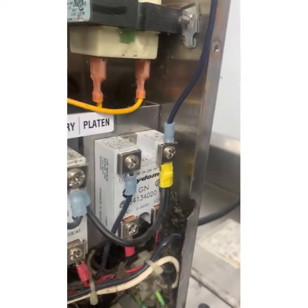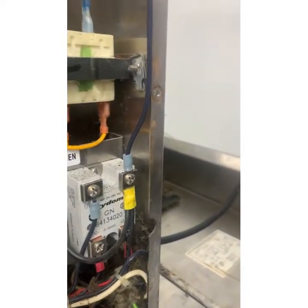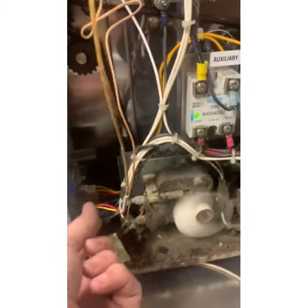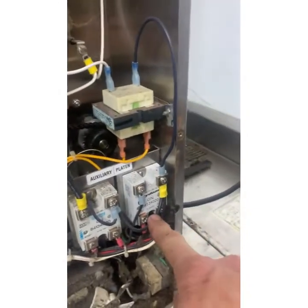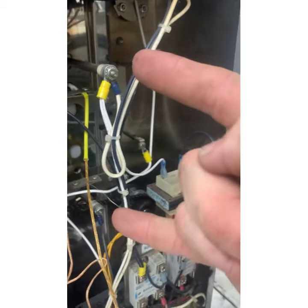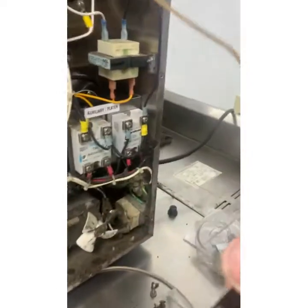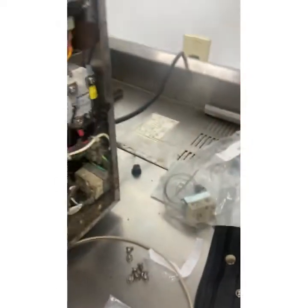You'll notice the relay for the air temp and the relay for the plate temp are sporadically kicking on and off. I pulled this, checked my voltage — this is the solid state relay for the primary plate. Voltage is present. I take my high temp plate probe, check it for continuity, and it's open — no continuity.